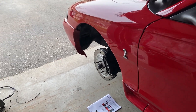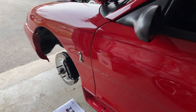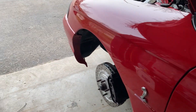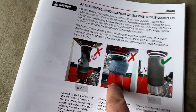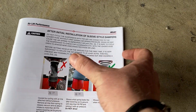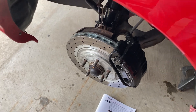So you're doing your air ride install, you get all excited, you got everything hooked up, you get power, you get a trigger, the compressor starts going. You got to be careful though — they recommend in the instructions that you fill each bag with at least 50 pounds of pressure just to make sure everything's straight and square. We only had it on one corner and the bag wasn't seated properly. If you drop the car with that going on, you're in big danger of ripping the bag. All you have to do is use the quick disconnect on the line, release the air from the bag, give it a little twist, and fill it up again. We had to do it two or three times, and the last time the bag finally straightened out and everything was fine.